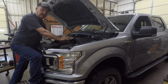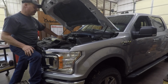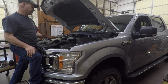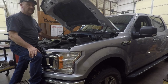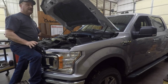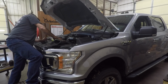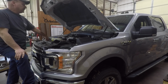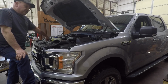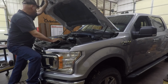If you have to add coolant to it, this takes a special coolant called Premium Yellow, I think, Motorcraft Premium Yellow. If you have to add coolant or brake fluid, either one of those, you've got a leak in the system somewhere. You should never have to add that normally. This one's right up here at the max level. That's pretty much all there is to this. I've just filled it up with oil. I put the cap on there. It's ready to go.